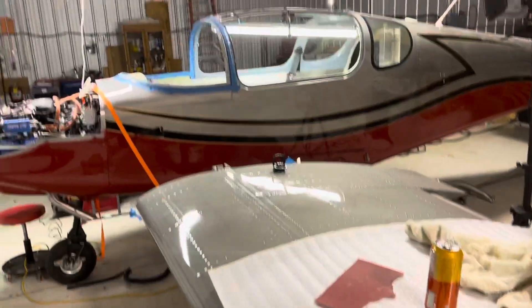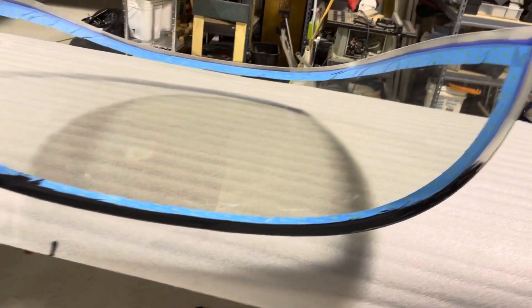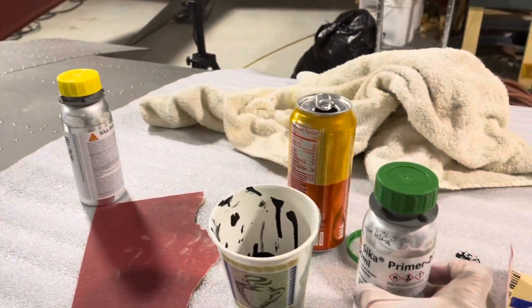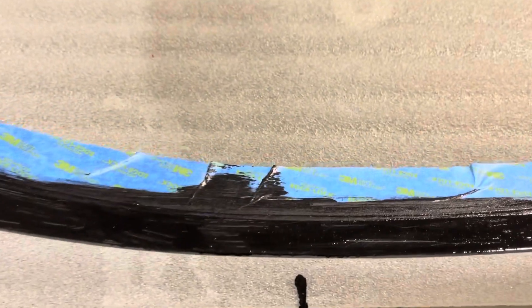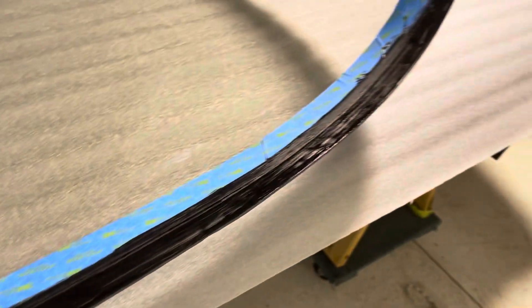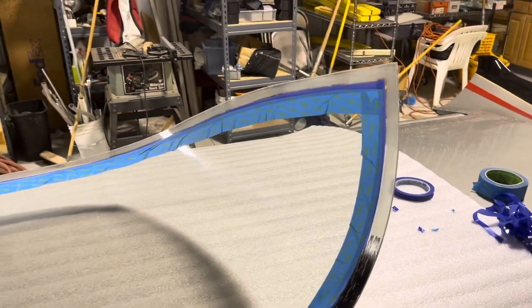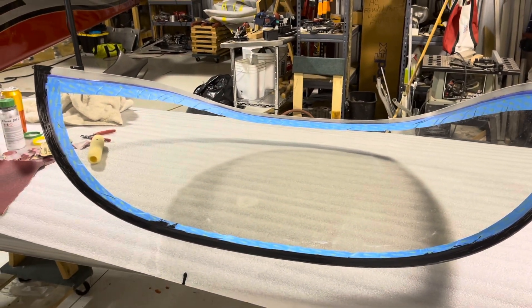After that we use some other SikaFlex stuff. Now I'm doing the primer - this is the Sika Primer 209. It's some nasty stuff, little black and gooey. So let's put some on the sponge and just dab it on. Careful, it does run - I almost got it under the main windshield and it does not come off easily. So also wear gloves. I did that activator stuff without gloves and I could immediately feel the burn. That's some nasty acetone-like stuff.